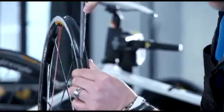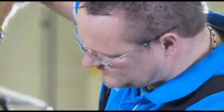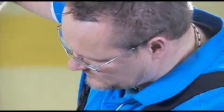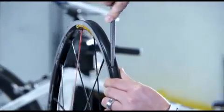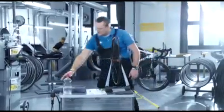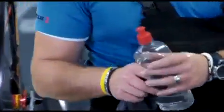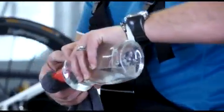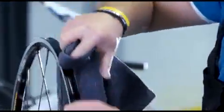The valve hole in the rim is often not cleanly deburred, which can result in radial runout or even damage to the tire. If this is the case, deburr the valve hole of the aluminium rim using a round file. If this is done, the valve area clings to the rim better. Clean the rim bed thoroughly of dirt, grease and oil using an absorbent cloth and benzene or acetone. Allow the solvent to air dry completely before you begin to apply the rim cement.